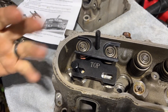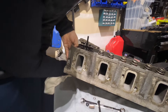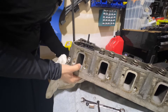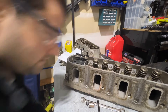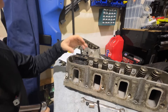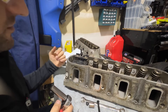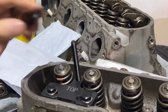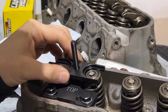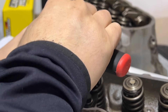There's a trick to make sure that the valves don't drop out on the other side — I'll show you in a sec. I'm going to take a t-shirt and stuff it underneath the actual head itself, so it spreads around inside the head and the valve springs stay seated. That way when it's all tight, it'll compress to the point where it'll allow me to get the four keepers out and the whole spring assembly will come out. I'm using a half inch to tighten it down — just get it nice and snug, we don't want to strip anything out.